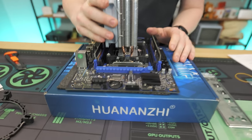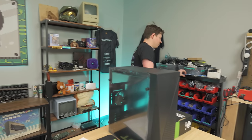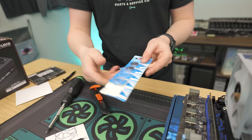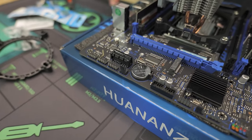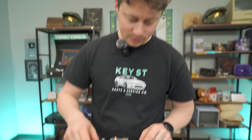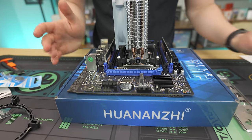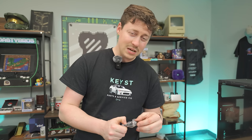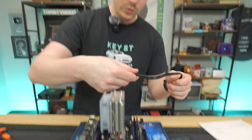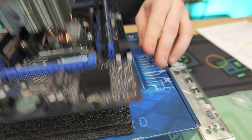One thing you'll often get with these boards that come from overseas: they usually cannot ship batteries. That's what powers the CMOS. Normally you never have to see us do this, but we're going to grab a CR2032 battery — there are a couple other kinds that will usually work in these. It just clips in. Now our CMOS will actually remember all of our settings, which is pretty important if you change anything. So at this point we have RAM, cooler, CPU, and the mounting bracket. We'll also plug in the SATA cable ahead of time so we don't forget it, tucking it behind the board. At this point, we've got a ready-to-go motherboard.